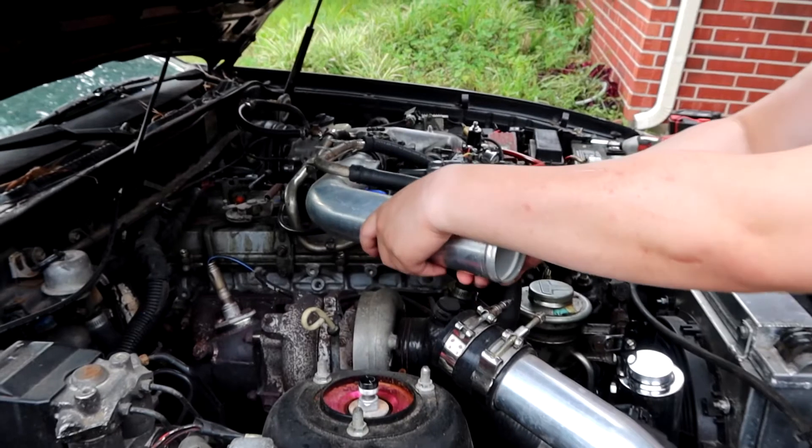You have no water lines on the turbo? Your water lines are not on the turbo - it's not water cooled. They didn't reconnect the water lines to the turbo. Wow. I mean with a journal bearing you don't always need water lines, but in stock form, why would they not just keep them? Maybe that's why it blew. Could be. I mean it's probably the old-ass turbo. The CT26 is not the best.